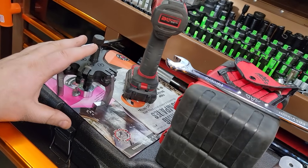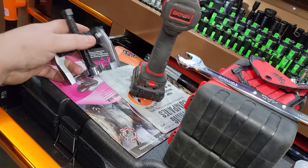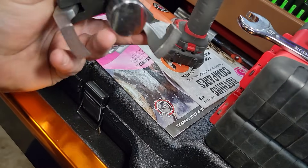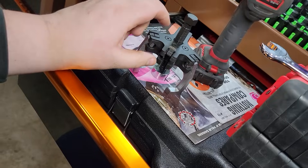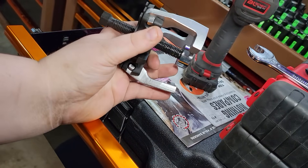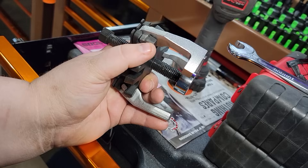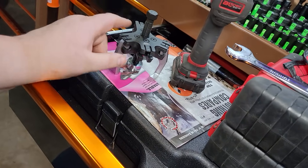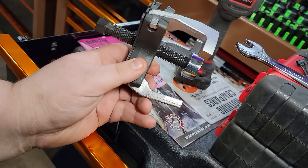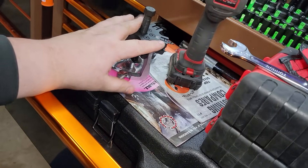Number four is the harmonic dampener puller for Chryslers and whatnot. The part number is LOHBP1, I believe. This is only exclusive to MAC Tools. You see the short arms — it's got a ratcheting deal on it and you can get in and take the pulley off. I don't think there's any other tool out there that can do it. It's a three-jaw or two-jaw puller, about $160. These things go on sale and are the bee's knees. It'll get into those Chrysler dampeners and pull off the harmonic balancer pulleys.